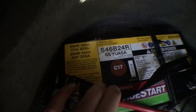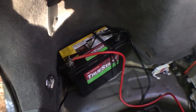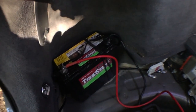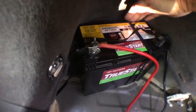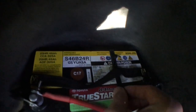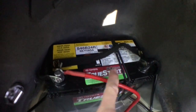They print the ratings for both — cold cranking amps and amp hours — right on the battery. They do sell one battery online that'll work, but since it was the same price I decided to just get another Toyota battery, went down to the dealership and paid $200 for it. I set the battery in there and behind here there's a flange with an island — I took two bands of zip ties and zip tied it in firmly. Wait to do that until the end because you'll need access to the two terminals.